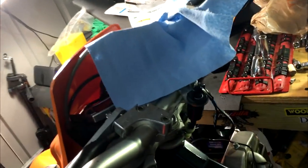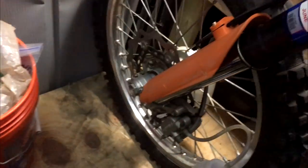I didn't record any of this because quite frankly it's a big pain in the butt, but check this out — turn that on, hit the front brake — I got a front brake light! I reinstalled the brake switch. It goes back in there, routed down here, and then it splices onto the rear brake one. That's how it's all wired in.